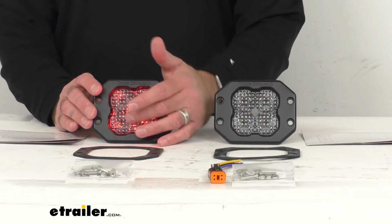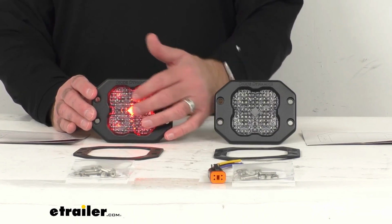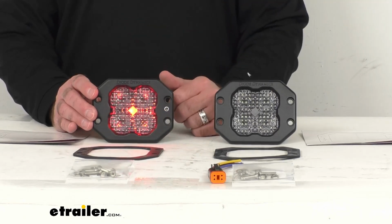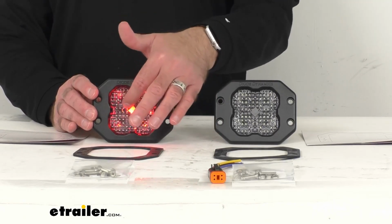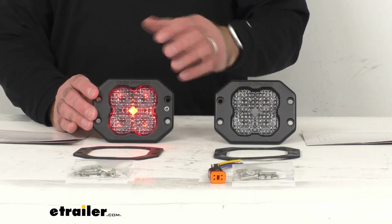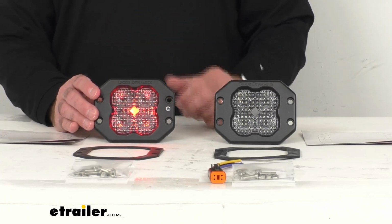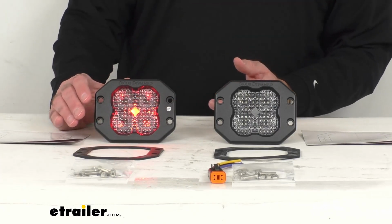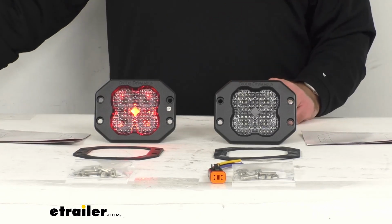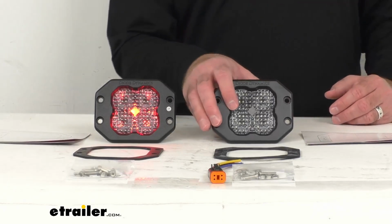And these lights have been designed with the newer technology known as custom TIR optics. TIR stands for total internal reflection. So unlike the older technology that uses reflectors or simple projector lenses, which aren't real efficient at focusing all the light where you want it, this custom designed large TIR optic actually collects and then focuses all of the light forward very efficiently. And from there, instead of having another external lens, certain lens patterns have been molded directly into the surface of this lens. So that's going to prevent the normal efficiency loss that you see with an outside lens. As you might know, when you shine light through any type of glass or plastic, you're going to lose up to 10% of that light just from it shining through. So by making it as a part of this lens, instead of losing efficiency, you're actually going to gain some efficiency.